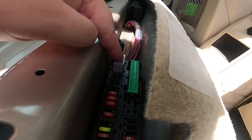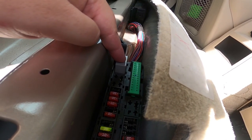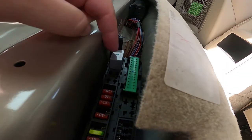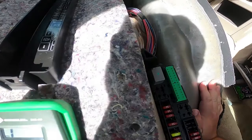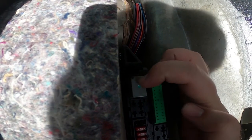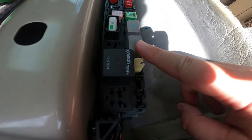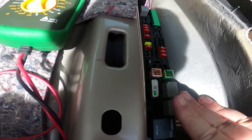I didn't hear the click on the relay. Put the key on but not all the way on. Okay, I just heard the relay. So the relay has little markers showing the direction it needs to go - there are marks on the outside. I took this one out and replaced it with another one; I got the same reaction. The relay is kicking on, so the relay is working.